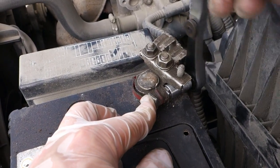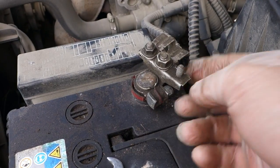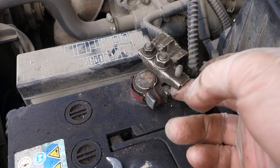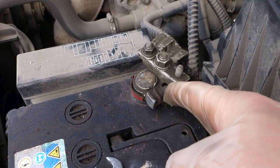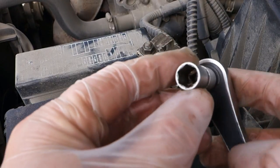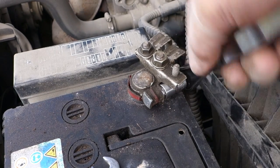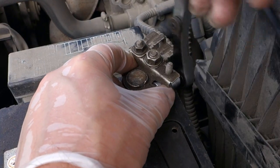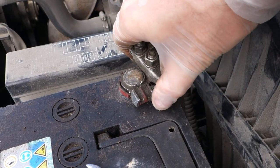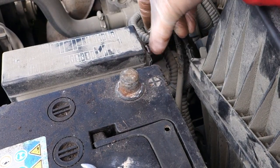And this is the difficult part, because this metallic part makes the possibility to open this nut very difficult. Because in normal cars, this nut is really easy to rotate, but in here, it is really bad. But now when I have this small socket, which looks like that, and a small tool, I managed to open that. And then I rotate that something like 10 turns, and again when this starts to move, look, this cable, I can lift that up. And this can be quite tight. And then I insert that in here.